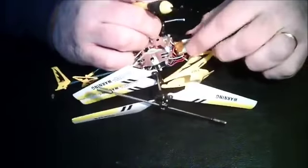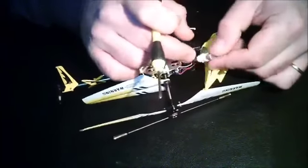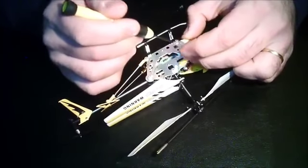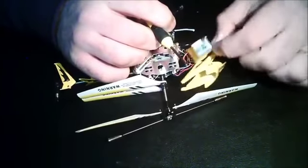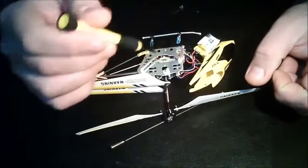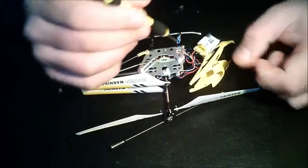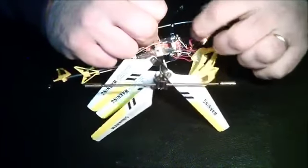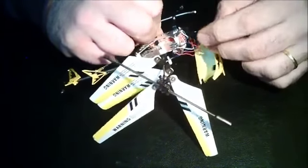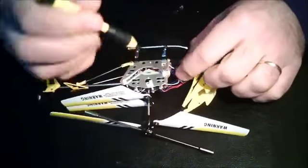Now let's take the battery out. It's glued with double-sided tape. It came out. This one, well, it doesn't say. I don't really know how much it is. So this assembly is going to be required: you need to take out the PCB board in there in order to take this out, unsolder it and solder the new one over here. So let's do that.